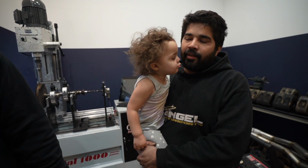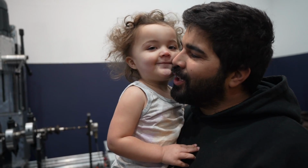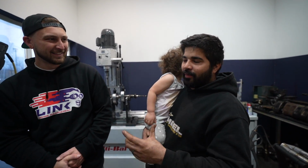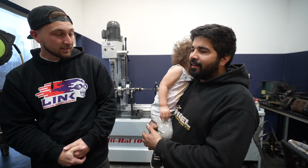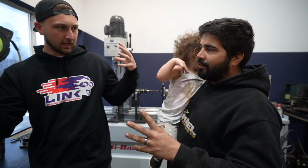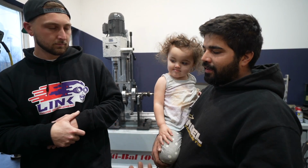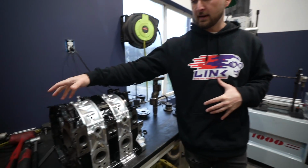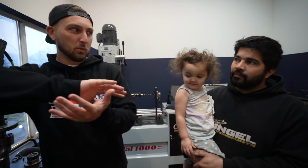The S4, the earlier ones, don't have reinforcements, and they usually crack at about 350 horsepower. It's such a weak point because the dowels are the only thing that keeps the engine together, like the head studs. Since the dowel is a weaker part, it will crack and leak oil. So we got the S5 housings, the later FC housings, which are thicker around, with castings sticking out around here. And if you saw the 13B REW, the FD engine, the superior engine, it is way more reinforced.